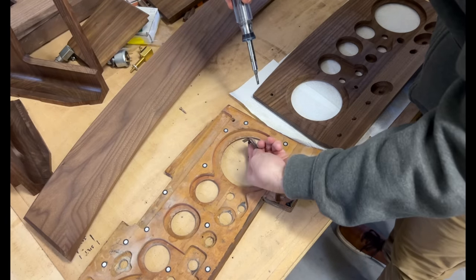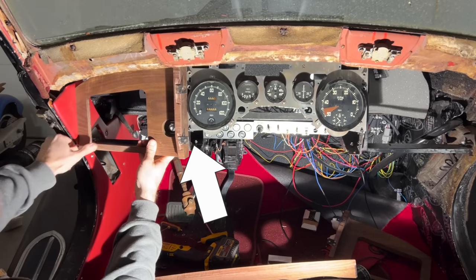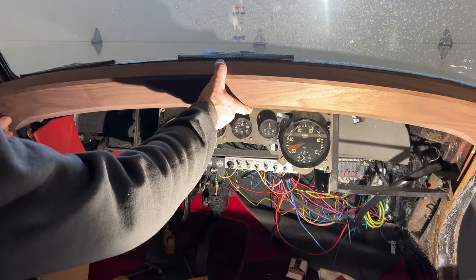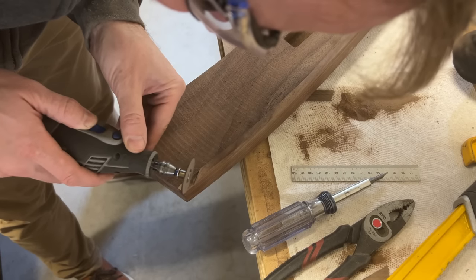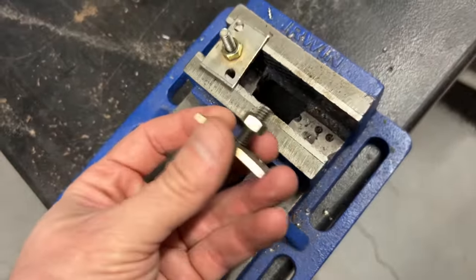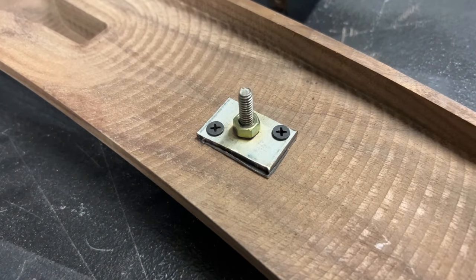The glove box and center piece have brackets screwed into them for mounting — I just transferred those over from the old parts. I was going to use new screws, but I don't have the right size and didn't feel like driving to the hardware store, so it gets the old ones. The dash is held at the top with bolts and at the bottom with brackets I swapped over. I made new stainless mounting stud plates because the old ones were tired-looking and used a weird Whitworth thread pitch that's hard to find nuts for. To get them in the right location, I screwed them to the car, put double-sided tape on the back, installed the dashboard in the right place, then unscrewed the studs and pulled the whole thing off with the plates in the correct location.